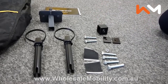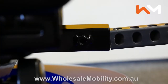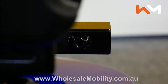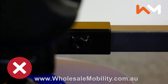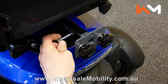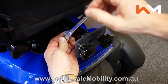You are now ready to mount the spigot. First remove the M6 ratchet handle. Next, insert the spigot into the accessory port underneath the back of the scooter as far as it will go. Before inserting the spigot, ensure the holes on the spigot match up to the holes on the accessory port. Choose to insert either an M8 or M10 bolt through the accessory port and into the spigot — this will be dependent on the scooter.